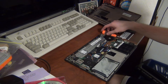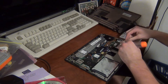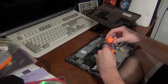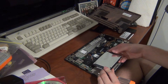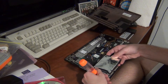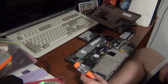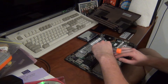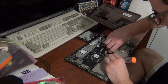The first thing we're removing is the little stand-in for the battery — since there's no battery installed, there's just a stand-in to fill the gap. Then we're going to remove the hard drive, or in this case the SSD. The caddy is held in by one screw and then the entire thing comes out. After this, you just disconnect the hard drive from the little cable that connects to the motherboard — we won't even need to remove this cable from the motherboard as it will come out with the rest of the motherboard. After this, there are a bunch of little ribbon cables towards the center of the board. These connect to the keyboard, touchpad, fingerprint reader, and all that. One of them you simply lift up and pull off; the other two have a little tab you have to lift before you can remove the ribbon cable.